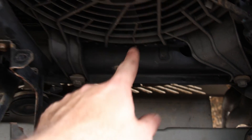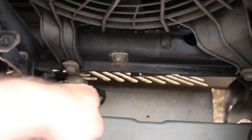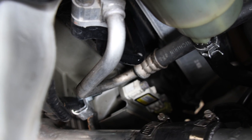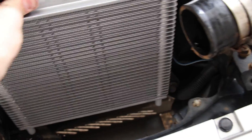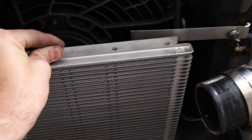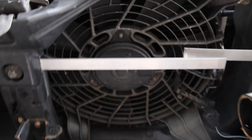Here's what I've done — it's bolted up nice and sturdy. I've also relocated the horn; it used to point upwards but I don't want it getting slapped, so I've relocated it to point downwards and it's now nice and sturdy. Take your cooler and place it there — that's essentially what it's going to sit like. Then just mark the holes with a sharpie and bolt it on.